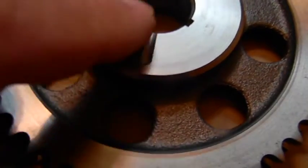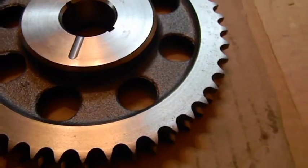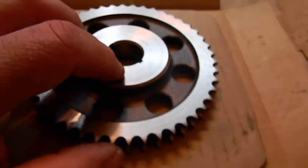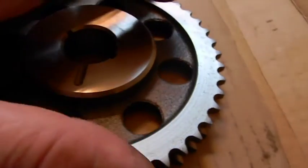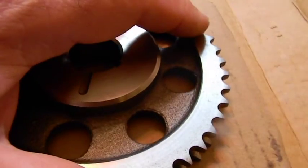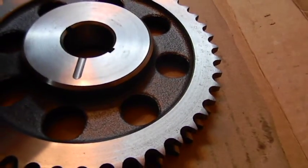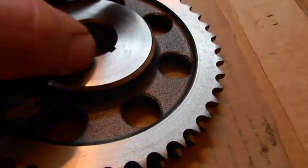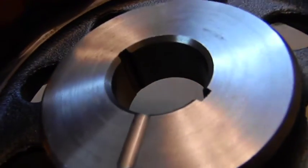The slot is much longer to find that hole in the cam — I'm not sure if it's in the right spot, we're gonna have to find out. I don't think the problem is with all the gears; I think the problem is with the actual cam. The cam vendors — whoever makes the blanks — are probably the same people, and they're drilling that hole in the wrong spot. So this might have to be modified, but the machining on the keyway slot and the gear looks really nice.